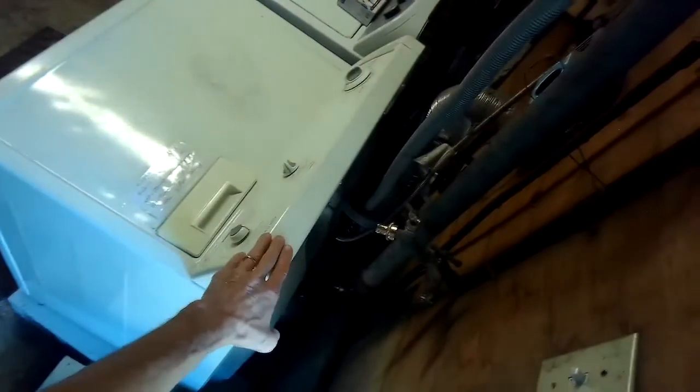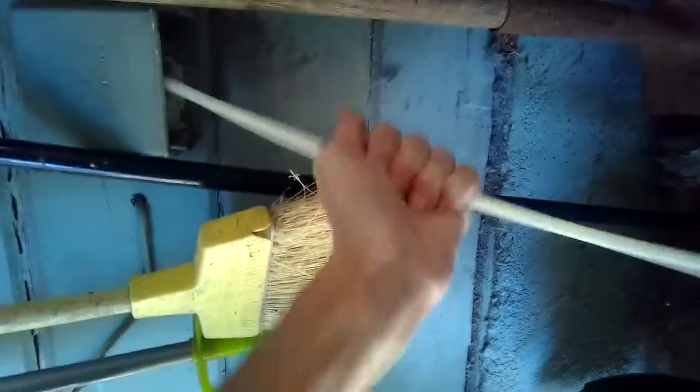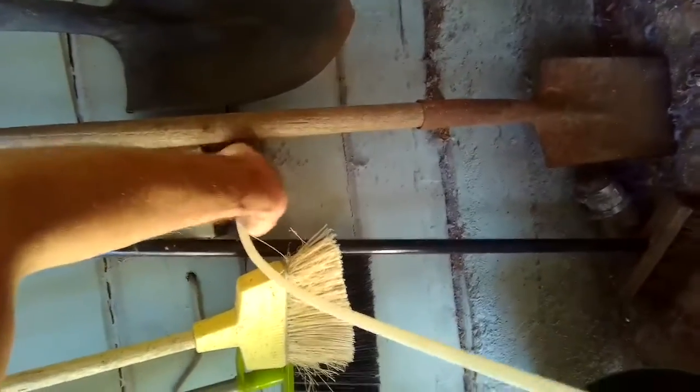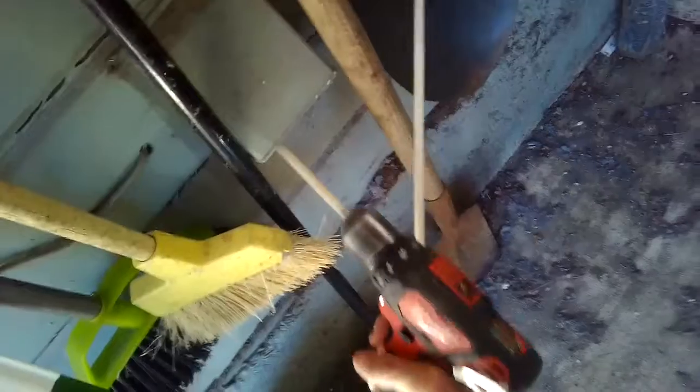Thanks again. So we just replaced the gas coils on this machine, but we're going to do a little vent cleaning. Tube is so short, there's probably very little in there, but do a little cleaning. I'm going to lift up on the flap, get this in there. I'll go and add another 3-foot section.